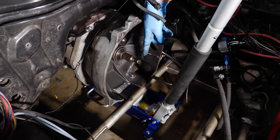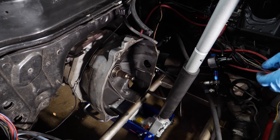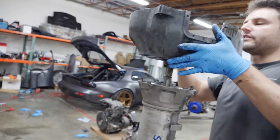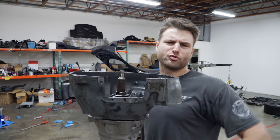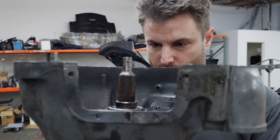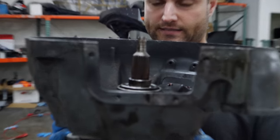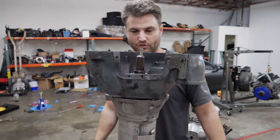What bothers me is that from here straight down, that's almost flush with the bell housing edge — and that's what we have to maintain as far as the engine is concerned on the two-rotor. If this sticks out too far, we're screwed. So it means threads start about an inch in — the depth of this bell housing has to be threaded. It's so different from just going to an online retailer and picking a Stage 1 or Stage 2 clutch. There are no stages when you're doing custom work like this — it's literally just: can I solve this with the maximum amount of meat and potatoes possible? The bearing at the very top bottoms out inside the flywheel, so we'll have to trim that down. That's the sort of thing you have to think about when custom machining these parts — there is no guide.